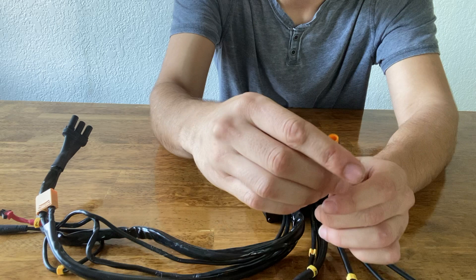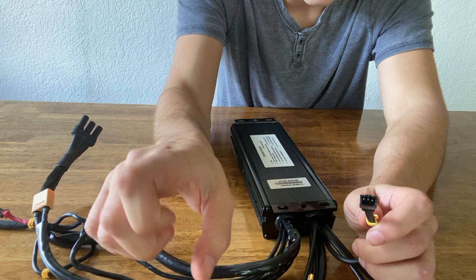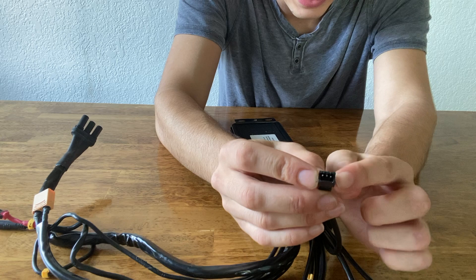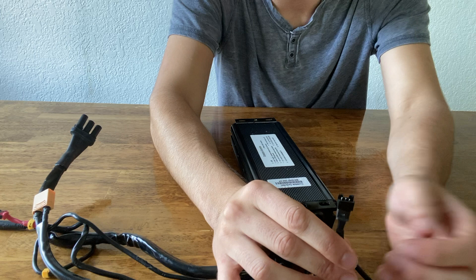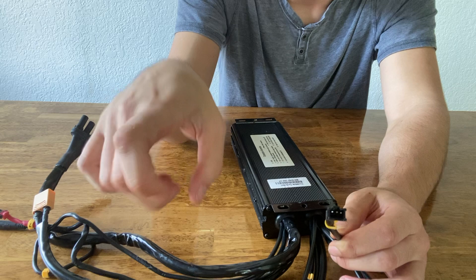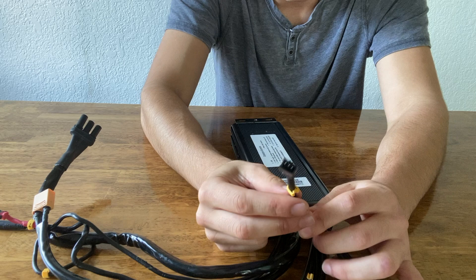This little connection is a 3-pin brake cutoff. It will be connected to your brakes and turns off the power to the motor as soon as you engage one. The middle pin is the signal, and the two outside pins go to either brake. If you connect the loop, it'll turn off the motor in case you accidentally whiskey-throttle it. I personally disconnect mine because I don't like the slight delay when you hit the brake and throttle at the same time — like on a hill or doing a burnout off-road. But it's good to have if you're a beginner.